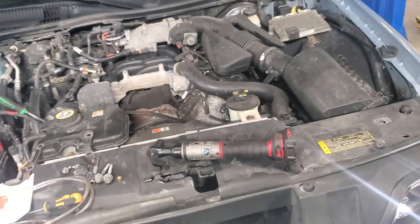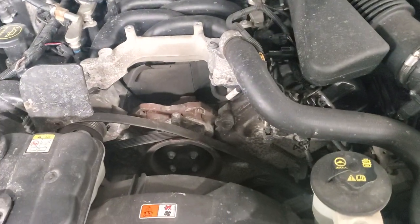You don't have to pull those bottom 13mm bolts out, but I'm actually going to clean the ground contact where it goes to the block, because it's part of how it grounds.